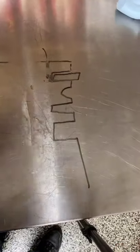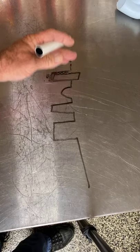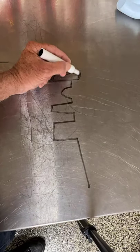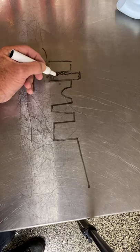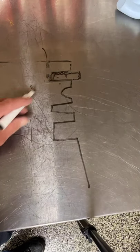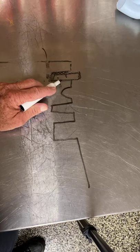You see this clearance? If you blew up the piston big enough, you would see a ton of clearance here. This is room for this ring to go up and down and lose seal, because the seal is only coming where the ring is mated to the bottom of this piston. That's why this ring land is so important in its finish, and the finish on this ring is so important. That's why I love the brand pistons we use, and you get the guys at all the great piston companies to do a nice